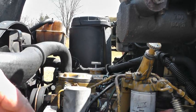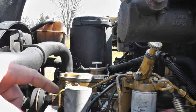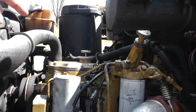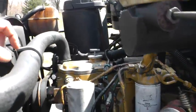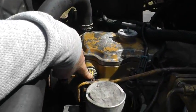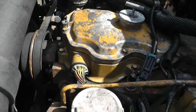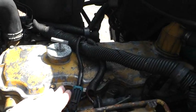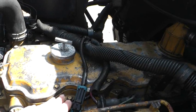I don't know everything about diesel engines, but I know this 3126 has a high pressure oil pump that drives the injectors. And they're electronic injectors — here's the electrical connector here. I'm going to pull off this cover, pull out the injectors, and send them off for testing and repair.